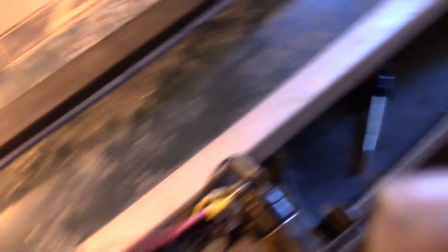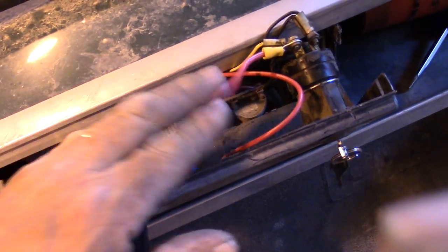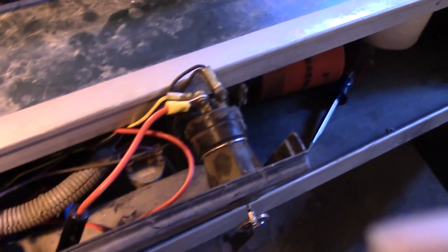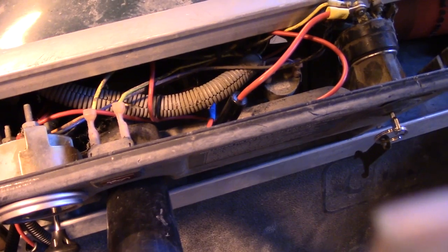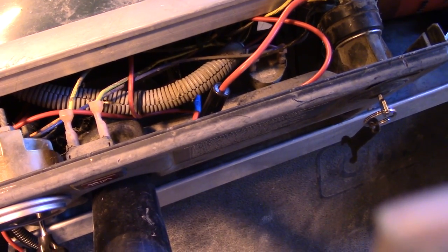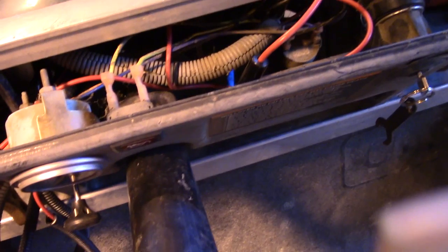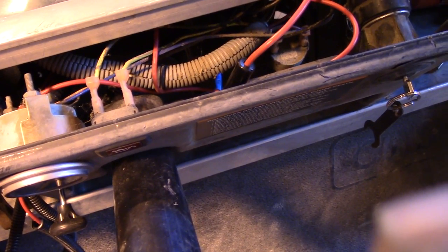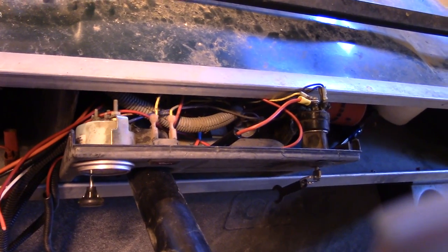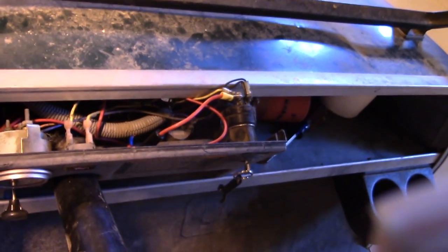When you're doing wiring — and boy I learned this the hard way — make sure you leave enough slack in your wiring so when you pull something apart you have room to work on it. The very first truck I ever owned, a '58 Chevy pickup, the guy must not have owned wire cutters because there were tons of loose wires under the dash. I neatened it all up and was so proud of myself, but then when I had to repair something — oh my god. That's when you run into problems. You want to have a little bit of slack so you can pull out a gauge or a switch.